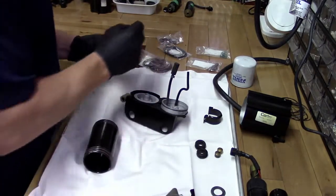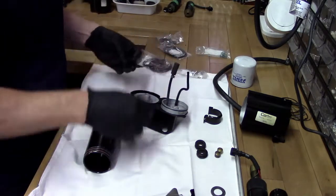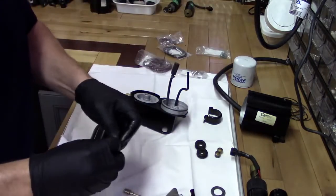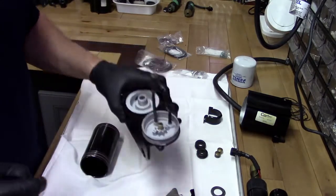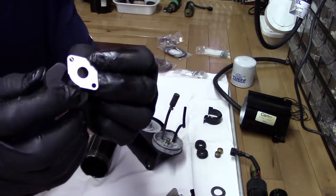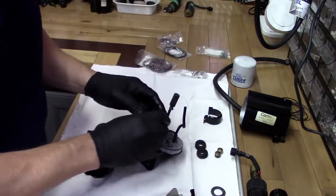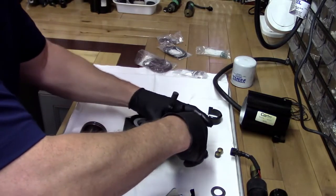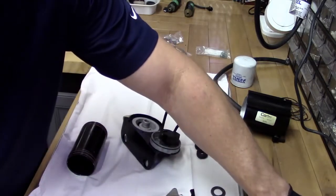Next step, we're going to take this valve that is attached to your float and then goes up to your intake manifold. It was looking pretty bad before, so I polished it all up with just some steel wool. It's a brass fitting. Slide your O-ring over that, and that just sits down in there. Your float only goes one way — there's the needle valve. You can see it hanging down there. That just slides right in, and that takes two Torx 15 screws.